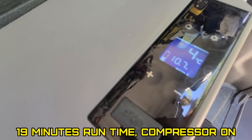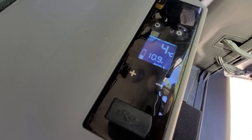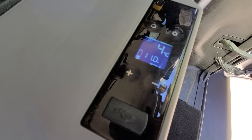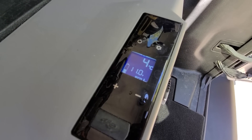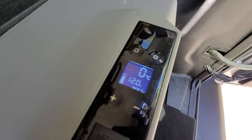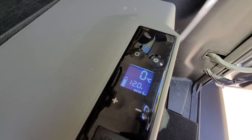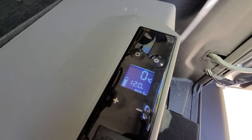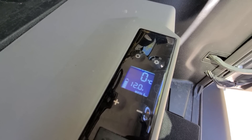Alright, another 9 minutes have passed. I hear the compressor still running. It's actually still holding at 11 volts. And we're down to 4 Celsius, so it's going to shut off pretty soon. I'll give it another 5 minutes and come back. The temperature's been satisfied — the compressor is not running anymore and we're at 12 volts. Look at that! So just for kicks I'll come back in another 5 minutes and see how well it charged the batteries back up.